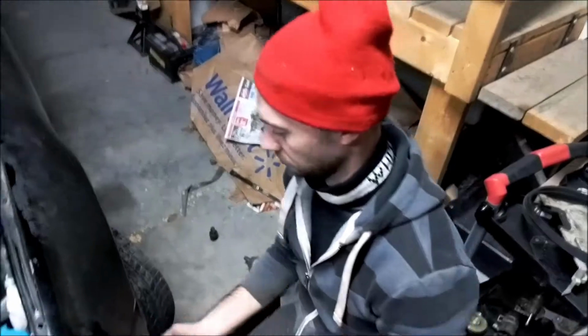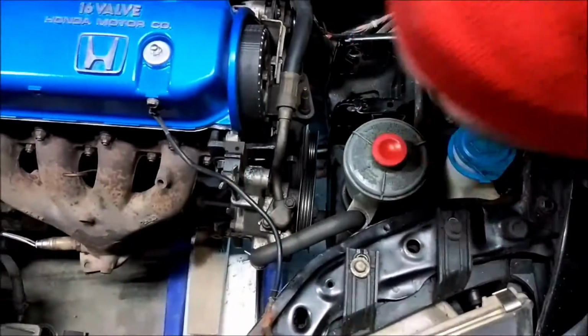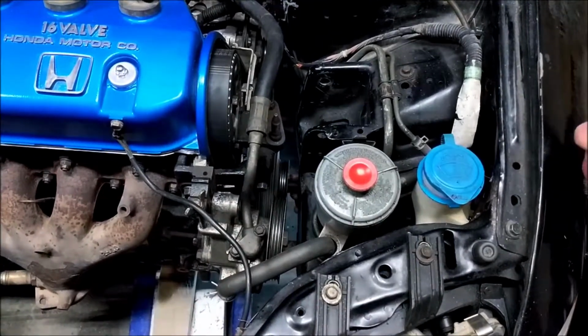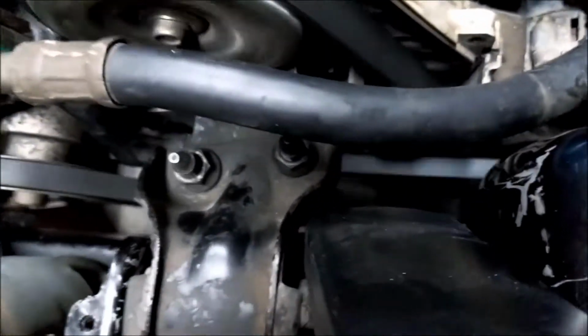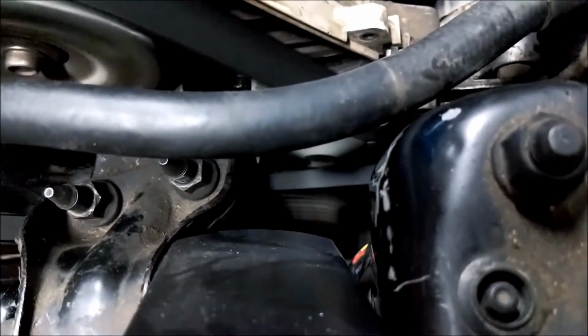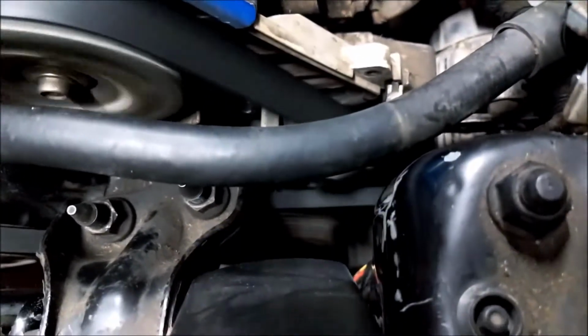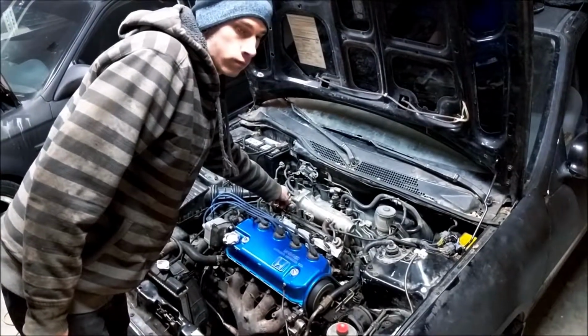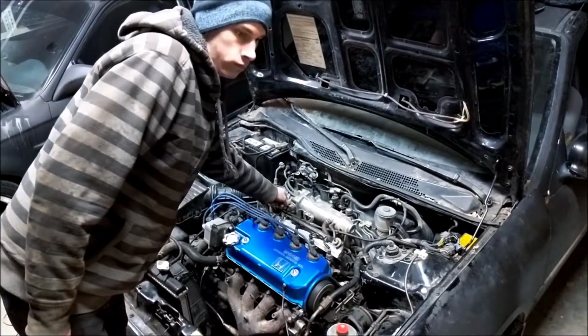Go ahead and install the crank pulley, and don't forget that key. Also, don't forget the two concave washers that hold the belt in place. Once it's all together and torqued, make sure to set the ignition timing on the motor. The last step, but most important, is give it some revs to make sure the race is still at 100%.